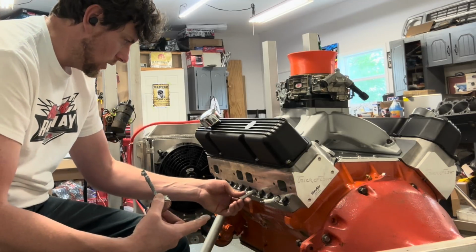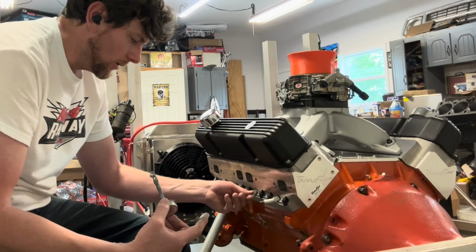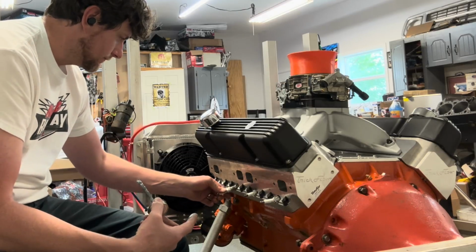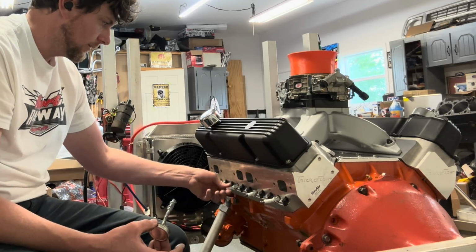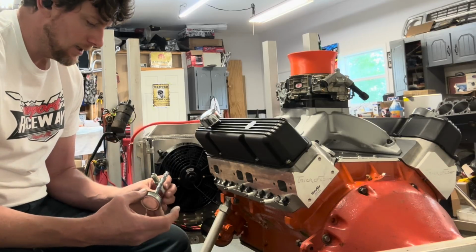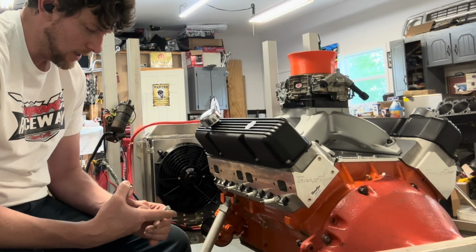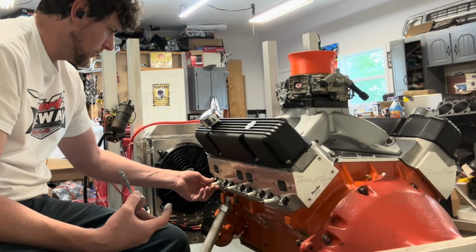So you're at a half a day just on the hookup, and then timing the engine takes just a few minutes, but putting all the wires on where they won't burn on the headers. I started putting my plugs in first before I put my headers on now. And that's actually a little time saver for me because everything's away from each other. So if I can just layer it in, it works out better, it seems. I'm getting these screwed in. These are NGK BKR7E, so the heat range of 7. This engine's around 12.5 to 1. He may want to change heat range if he runs nitrous or something, but these are the same plugs I run in mine, and they seem to do really well. The V-Power, there we go, BKR. I think the R has a resistor or something.